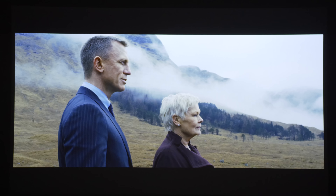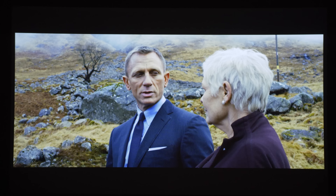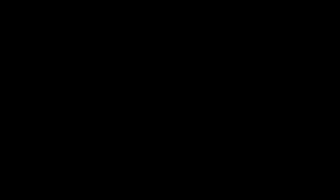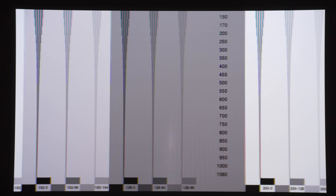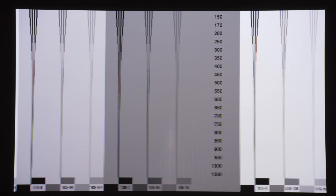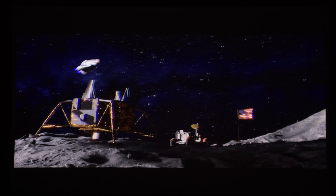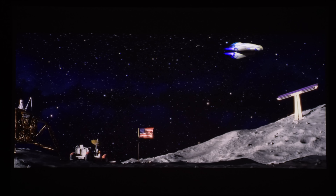Continuing our discussion about picture-affecting settings: there is no gamma control on the Xiaomi Mi Jia 1080p projector, so gamma is fixed at 2.2, which gives a bright punchy picture, although most video enthusiasts would have preferred a 2.4 gamma for watching in a dark room. Motion resolution stayed at the sample-and-hold baseline of 300 lines owing to the absence of any motion interpolation technology on board. The projector's refresh rate is locked at 60Hz, so 24Hz film material and 50Hz broadcast content would exhibit some judder.